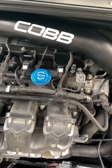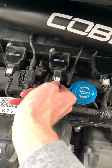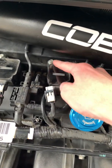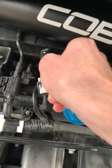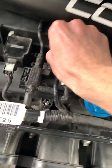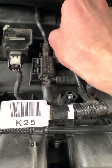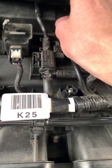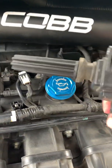I'm going to go over how to change your coil pack really quickly. The first thing you want to do is unclip it — push down on it and then pull out. It takes an 8mm, and obviously you're not going to want to use a socket with how much room you're working with, so get yourself a little 8mm wrench and position it just right. They don't have to be tight at all — just loosen it and pull the bolt out. Pull the bolt out, take the coil pack, kind of twist it a little bit, and pull it right up. There's your coil pack.